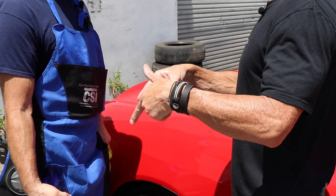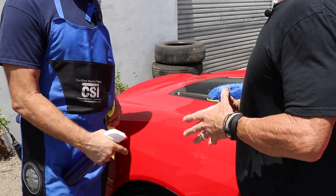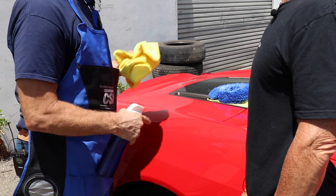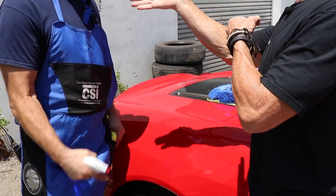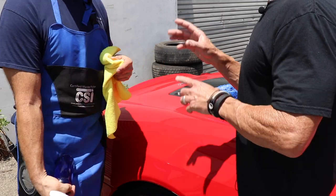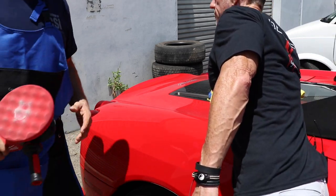Tom did the heavy lifting with the low-linting cutting pad. Where do you go from here? It's hot out — I can feel the drips down my back. If you're a mobile detailer stuck in front of somebody's house with a rotary and also a dual action, I would kiss it with a DA and it would be perfect. You don't need to use the rotary with the foam — you can go wool right to DA with the red foam pad and be done.